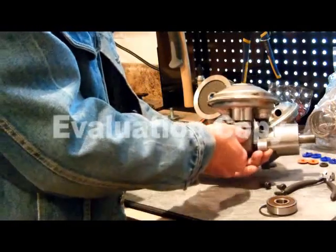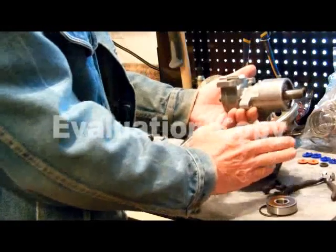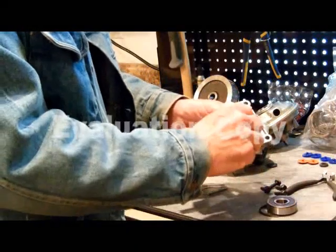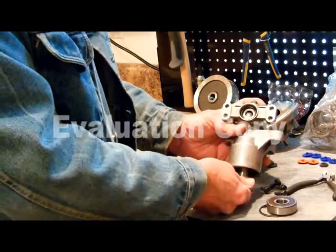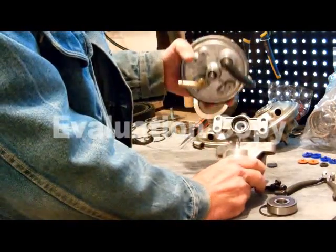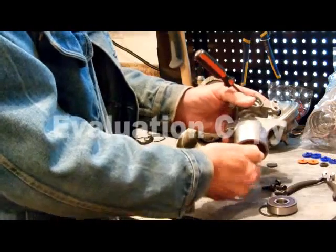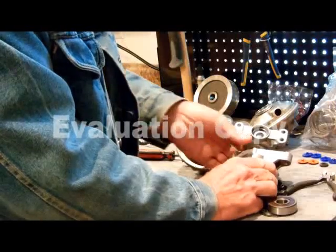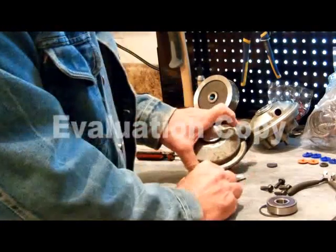You take these four little 10-millimeter head screws out that hold the diaphragm on and remove the diaphragm. Now inside here there's a little black O-ring — you want to make sure you replace that with the new O-ring that comes with the diaphragm. Also inside there's an eccentric or cam you can see turning, and that's what activates the push rod in the bottom of the diaphragm. You can put a screwdriver in there and gently turn it — when it comes up you shouldn't be able to turn it at all, and then you're sure the shaft inside the lower unit isn't broken.